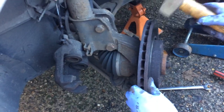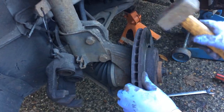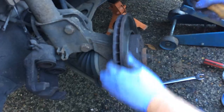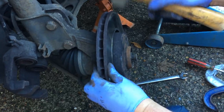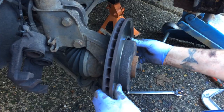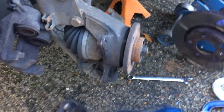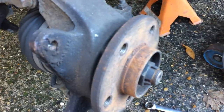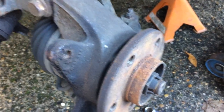Be careful when you're hitting this cast iron - it's a brake component as well. Try to concentrate the blows on the hub area to loosen up the rust. Just keep working your way around. So that's the disc off - let's whip that off. What we're going to do is make sure we clean all this rust off the hub so we get a good fitment on the new disc and it runs true.